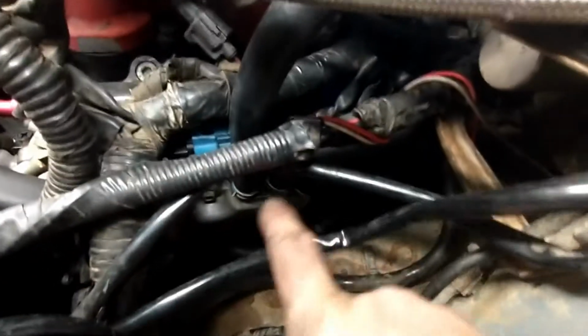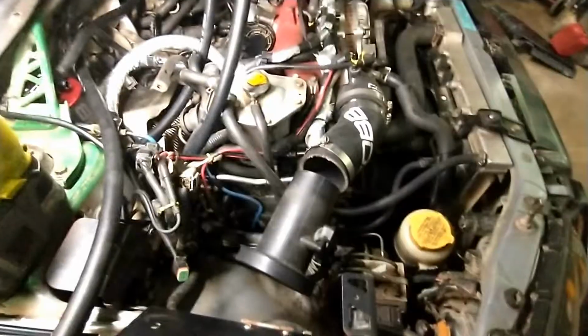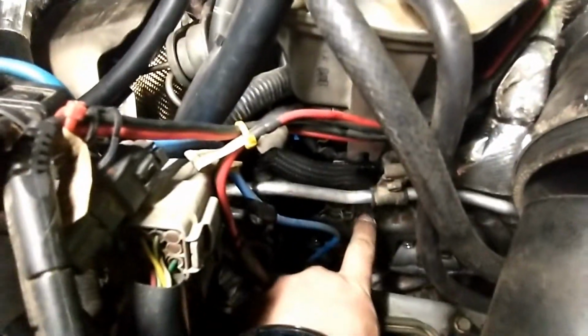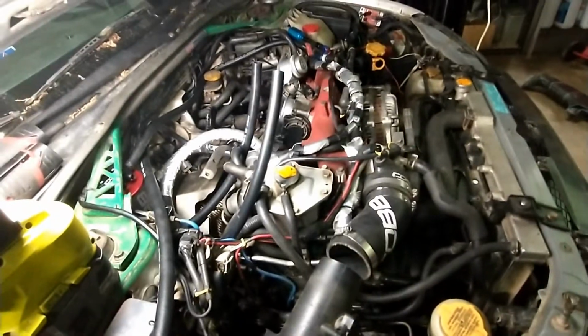Okay, so here I put the new hose in, routing here away from the heat sources. So I went behind the clutch master there. I'm gonna run it along the firewall and go over there. So on the passenger side, I removed my airbox shield to have more access. We're gonna remove this guy here that was going here to the intercooler as well. And we're gonna put another hose that's gonna go at the top of the bottle.